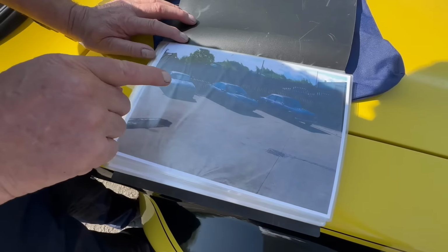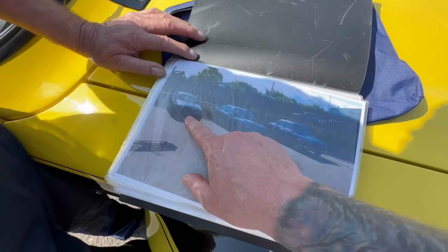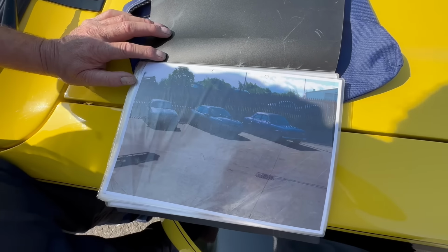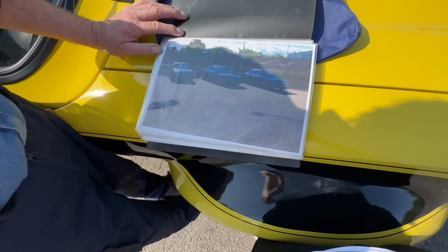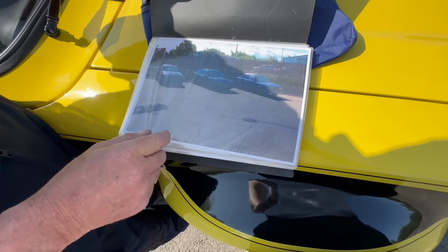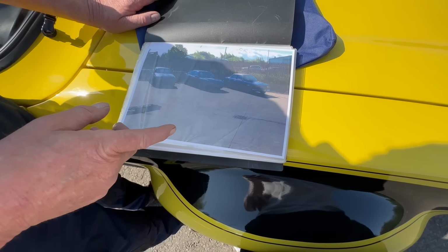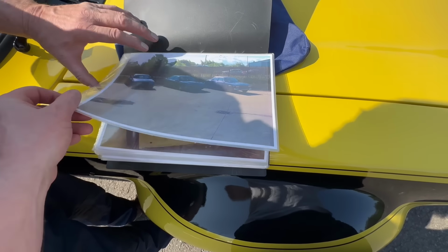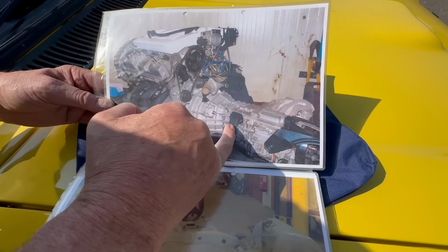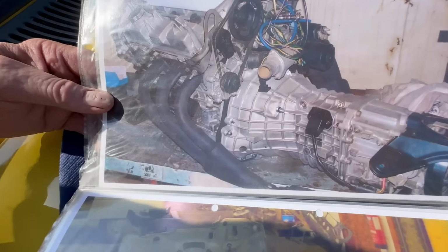That was the three cars. So that's the Mark 1? That's the Mark 1, the Mondeo, and the Sierra. Is it a Cosworth, or was it just a 1.8 or something? Oh, right, the XR4i. Yeah, XR4i, but it runs the same suspension, I believe. Is it the same gearbox tunnel? Well, that was the 4x4 gearbox, yes. Right, so it's a bigger tunnel. It uses the same suspension and brakes as a Cosworth. So then that was the unit that I made. You had to make up an adapter plate to fit the MT75 box on. That's my own manifolds that I made up. You see?